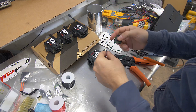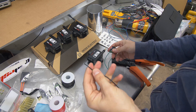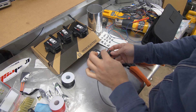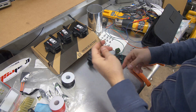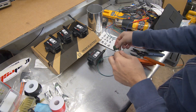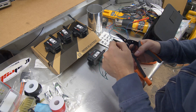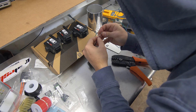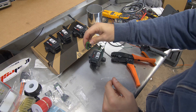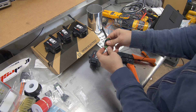Now that we have our trigger connection, we're going to make our three grounds. I'll start off with 20 gauge wire for each pin, and then the outputs I'm going to tie together to the actual rotor housing. We'll do the same process — slide it through, strip some wire, get our pin, place the wire, and wrap it down nicely. We have two out of our five pins connected, so now we're just going to speed through the rest of these.